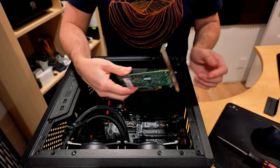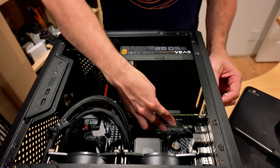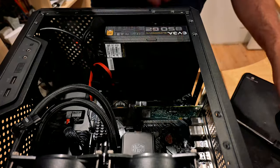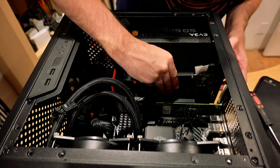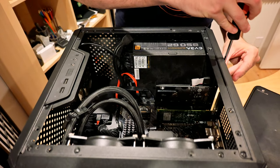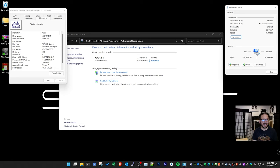We've got our ConnectX3 and we're going to put this in the top slot, which should give it access to all the PCIe lanes it needs, hopefully getting us to 8x capability. We can now see that we actually have a full PCIe at 8 gigabits per second on an 8-wide lane — drastically different than what we were seeing just a few minutes ago. That explains the difference between what was being reported as the negotiated link speed and what the realized link speed actually was.